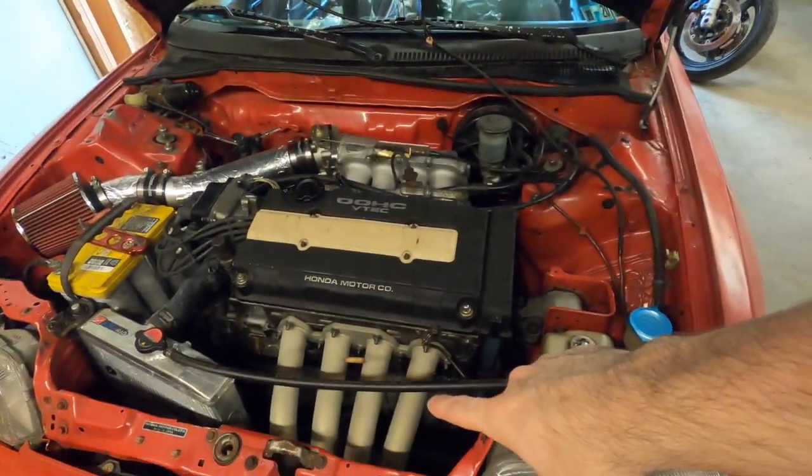Also with the vibration, I have a rattle at like 2800 RPMs. So this manifold, it's an eBay manifold that someone put a megaphone on and sold it. Whatever. Bought it for the megaphone, that's literally it. It's very thin metal, so I think it's moving around a lot, so I need to make a brace from the megaphone to the engine. Normally, factory exhaust manifolds have that.